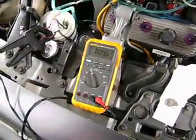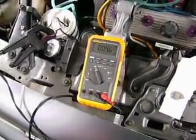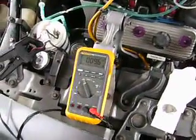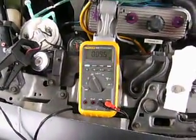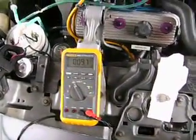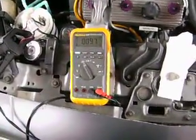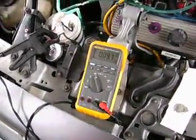In the other video halfway through the trip, I mentioned we were only reaching like 12 amps when I started at 5. So that's a repeated observation — the current swing is way lower than the original design. 21 amps hot, yet it reaches the same temperature that the other cell does over time. It just takes longer to reach the maximum temperature. At the end it was like 190°F, but that's normal. It takes twice as long to heat up as the original cell, which is part of the reason why you can start at a higher cold current draw on these long trips.